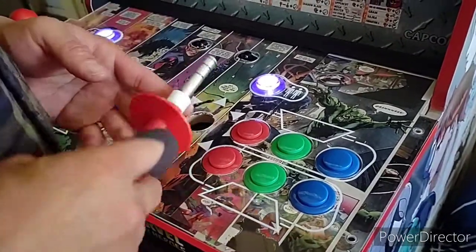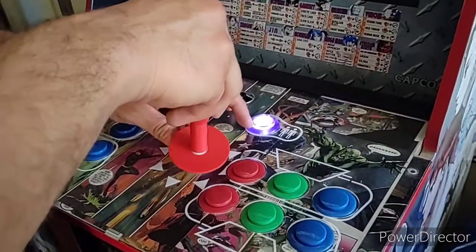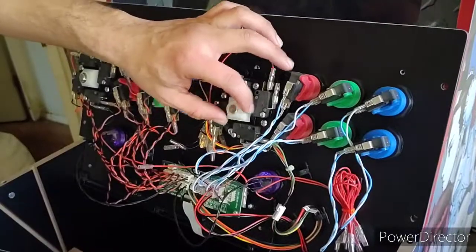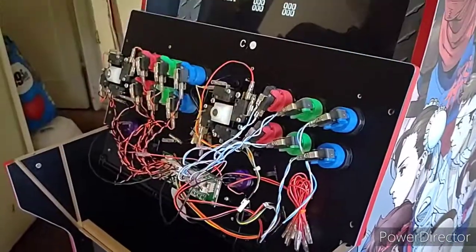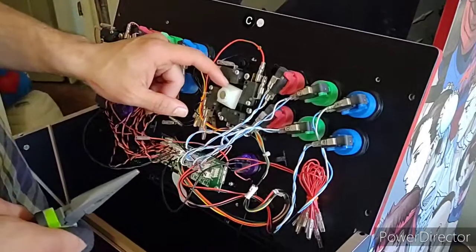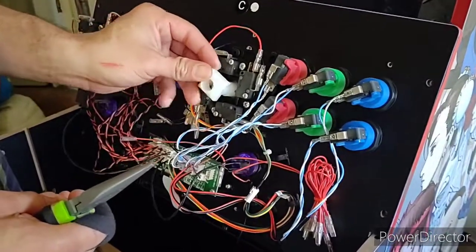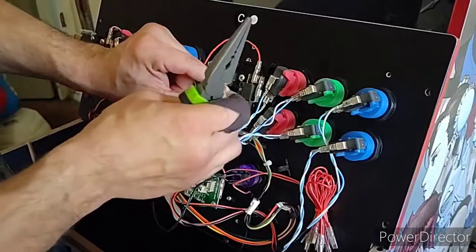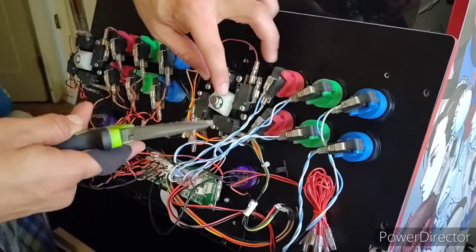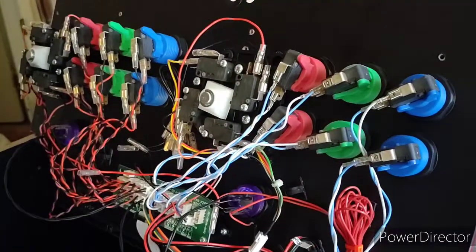The stick is now properly centered, and like I told you before, you put your dust washer in first, and then this pivot point all the way through, down to the other side. Now the actuator stayed on. All I need is the C-clip. Now apparently this actuator is mounted to the actual plastic piece here, and not to anything else. So it's not mounted to the stick. So when you press down, you're not pressing down on the stick. You're pressing down on the plastic portion, and that's it. Get your E-ring in as much as possible. You press down and then clip. That's it.